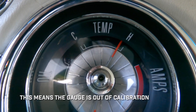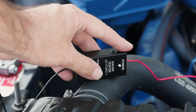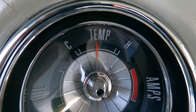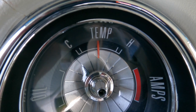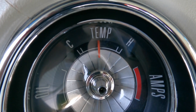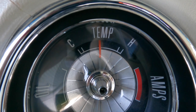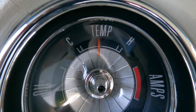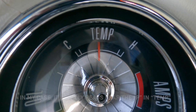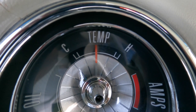And that's supposed to be the most accurate side of the scale. Let's try the medium setting. That's had a little time to sit, and look at that — it's bang on in the middle. That's a perfect neutral reading. And this tells me that my sending unit, which is an aftermarket one, reads a little bit high, because when I'm driving around at normal operating temperature, the gauge is actually up there in the high range when I know the car is not running hot — it's actually normal. Those aftermarket temperature senders are known to read a bit high.